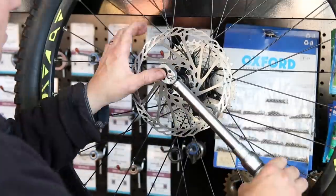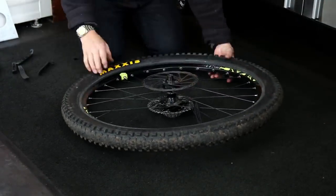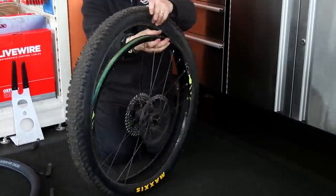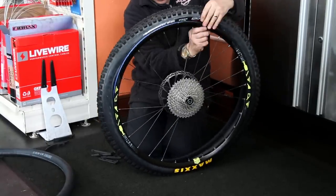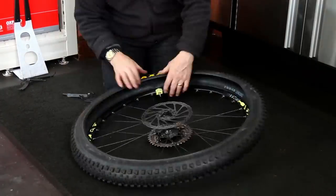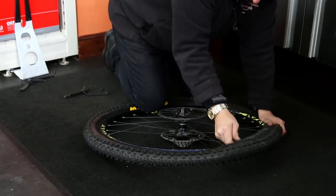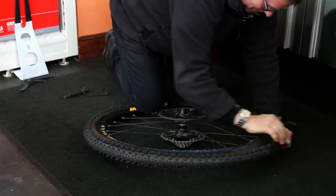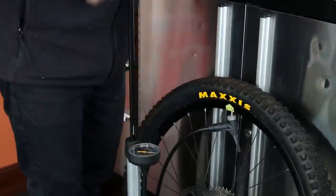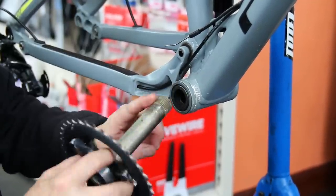On goes the new cassette, torqued up as well. Then the customer asked us to replace the rear tire - this is a Maxxis tire. These are thick-walled, heavy tires, but if you're off-road going through rough gravelly, flinty, rocky ground, these Maxxis tires are great because they're almost like a motorcycle tire. That does make them extremely hard to put on - I do have to use tire levers and break a sweat. With these ones I actually over-inflate them initially to bead them on the wheel, then release the pressure down to the correct level.